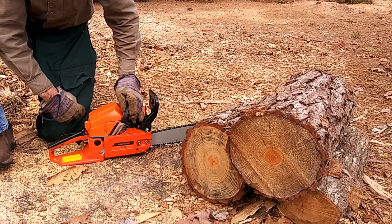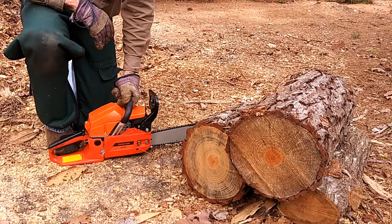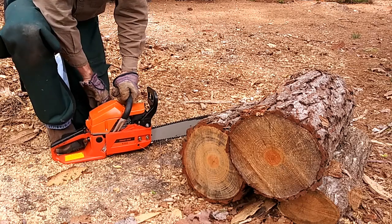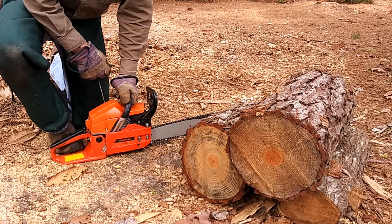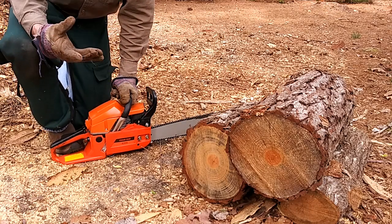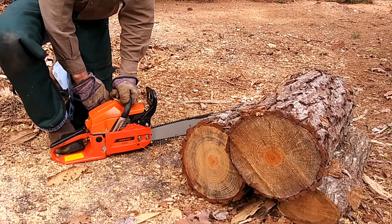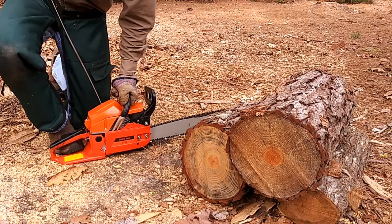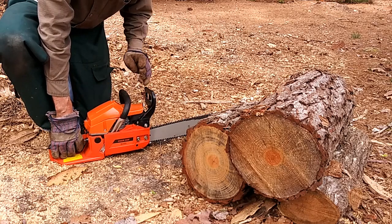To keep it in camera we'll go ahead and start it right here on the ground — I know I've got it aimed kind of low, so this wouldn't be a normal start position. We come up until the spring hits. You probably heard it real good that time — she burped and was trying to run. So we push the choke in, make sure the brake is still locked, hit it a little more, and it's going to fire. Then we release the brake.